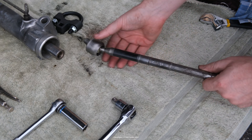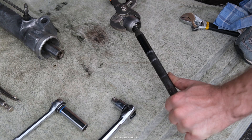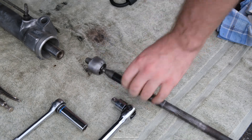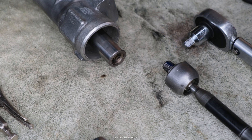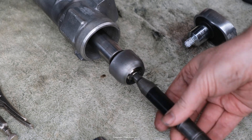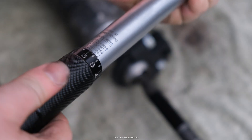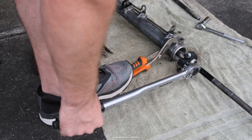Check your replacement rod is identical — if the length is different, the positioning of the outer rod will be different when you thread it back on. You can see this replacement rod is not straight; I had to hold the socket side with vice grips and action it with my foot just to get it straight, which shows how stiff the ball joint should be in good condition. Some vehicles have a locking pin that inserts into the thread after installation, but Ford relies on torque alone here, so I figured some Loctite wouldn't hurt. Thread the new one on, then it's a reversal of the removal process with a torque wrench — the Ford spec torque is 110 Nm, which is quite a bit, so dial that in.